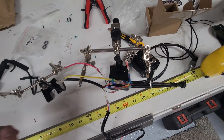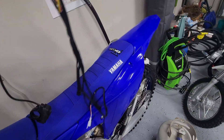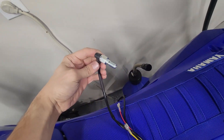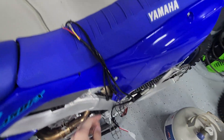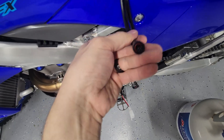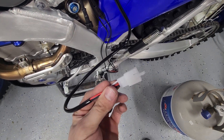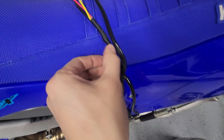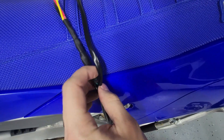That's pretty much all the complicated wiring you're going to have to worry about, and I just solder everything so it won't come apart. This is the completed wiring harness. We've got the banjo bolt, the bar switch, and the horn connectors on one side, and then we have power — which is these two — and this is for the taillight. Then we have the fork lights down there, and this is to trigger the relay. The black wire is not used — I just clipped it on the other end. Everything is all tidied up, and I'm going to throw some electrical tape around that really quick too.